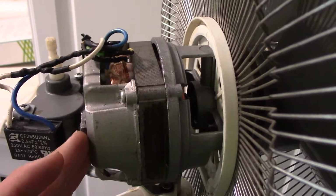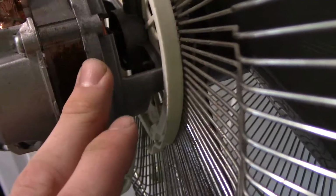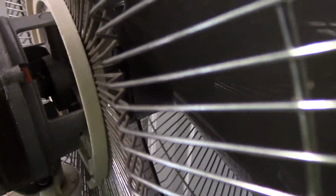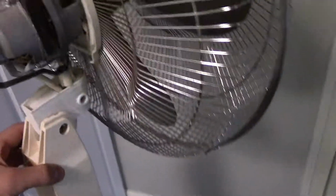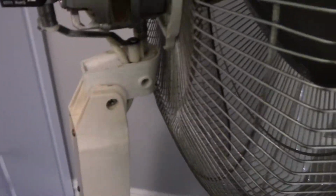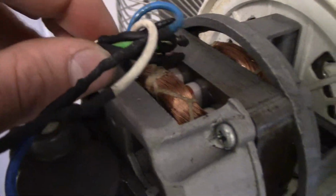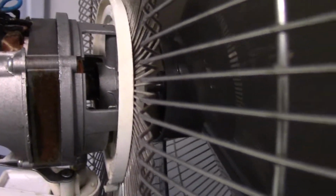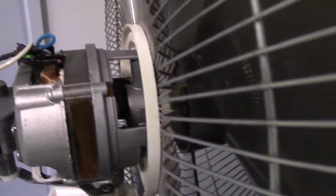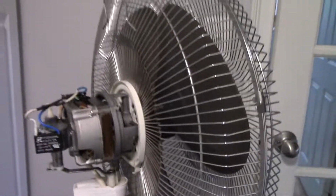But I took it, and what I've done here is I've taken the windings and back cover from that newer motor and fit it with the rotor and front cover of the old motor and made a Franken Motor. So it's a blend between the new and the old, essentially, and everything fit together like it was meant to be that way, which is kind of interesting. Yes, at some point I cut the wires way too short, so I needed to solder those back on. But after a couple of fiber washers went into it, it fit like it was meant to be, which I thought was very interesting. So that's the Franken Motor.